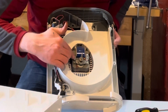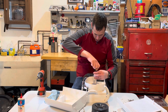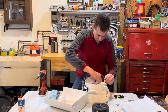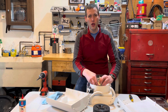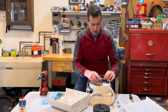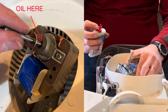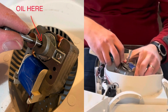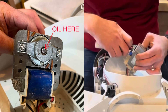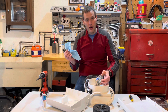Next, to remove the motor, I'm going to take out these four screws that hold the motor in place and remove the mounting pieces and mounting screws. Now that I can remove the motor, I can oil the bearings. There are bearings on each end of the motor shaft, which is called a rotor. I'm going to take 3-in-1 motor oil — this is made for electrical motors — and put a couple drops on each bearing, then spin the bearing. Next I'm going to take a paper towel and clean up any excess oil.